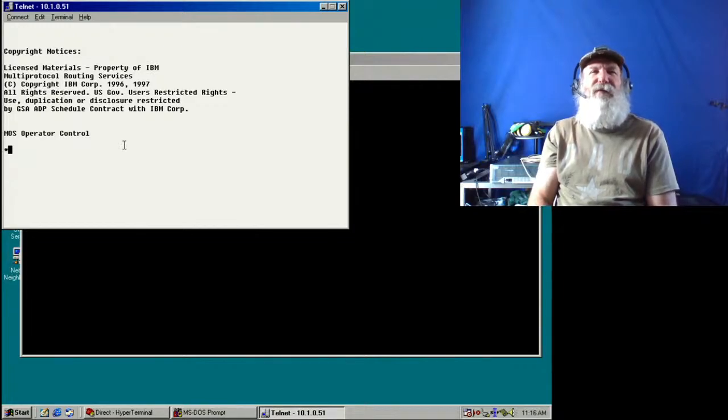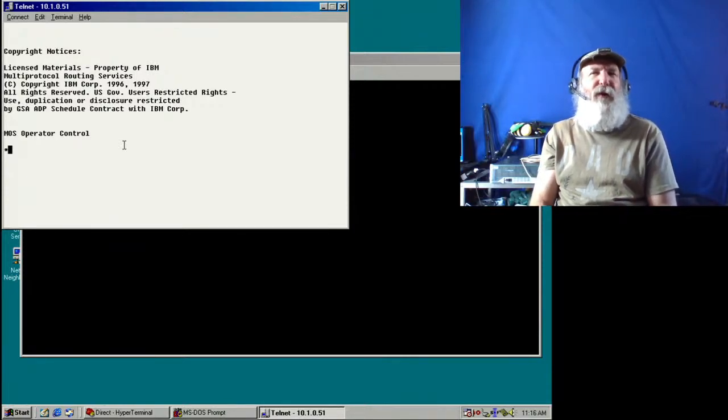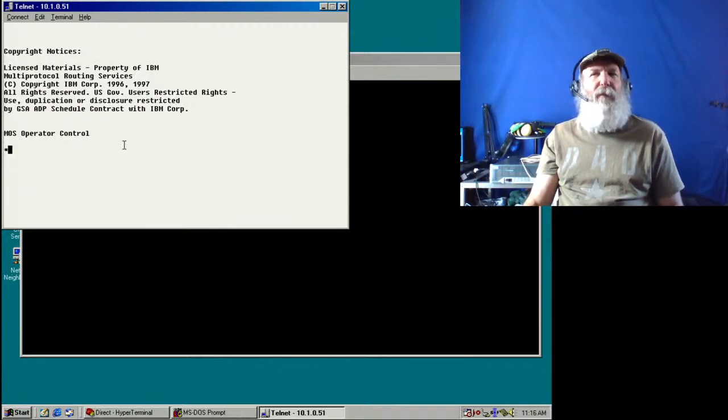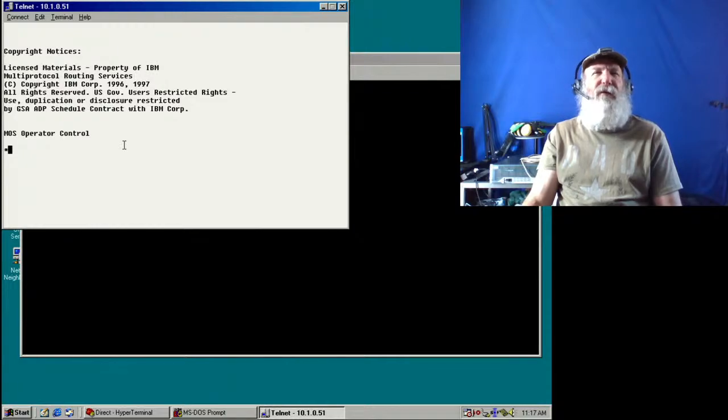I'm going through the setup routine, and the 2210 is a router. To me, the notion of transparent bridging is not there. The concept of having the token ring as a separate subnet to the Ethernet subnet. And down the road, I almost want to maintain the separate subnets and not necessarily do transparent bridging, because to me, with transparent bridging and everything being on the same subnet, I don't like that aspect of mixing everything together, of not having separate subnets for the type of devices.